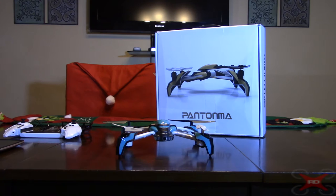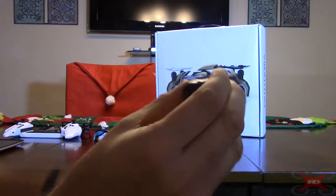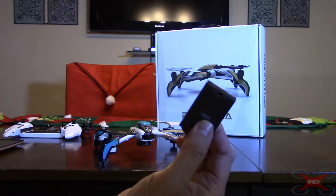It's mentioned on the box. There's a lot of modular stuff about this. The battery goes in the back and it is a proprietary battery — that's a bit of a downer. It's one of the most unusual batteries I've seen. The instruction manual says it's a 650 milliamp, and I'm sure it's a 1S LiPo judging by the size. It has an unusual charger — a USB cable with a little plug that goes into the side of the battery.